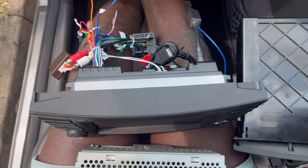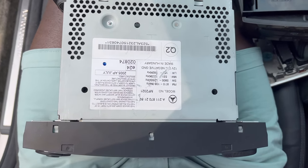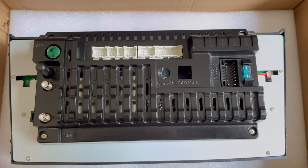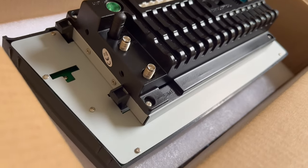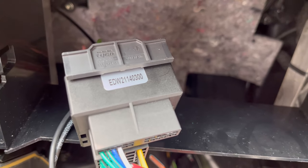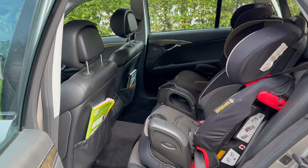Should you buy an Android head unit? I say yes. If you've never upgraded the head unit in a car before, the first thing I recommend is that you take apart your current head unit and look behind it. Before ordering parts online, it's good to do your research. Sometimes manufacturers have variations depending on where you live, the model year, the engine and also the trim. The best thing to do is to take apart your current head unit, look behind it, take pictures of the cavity, your cables and the pins. That way, when you look for a head unit online, you'll be able to check and ask questions to find out whether the one you want will fit in your car.